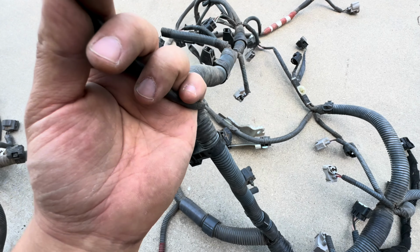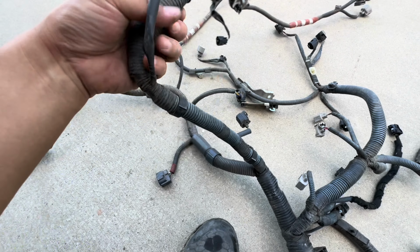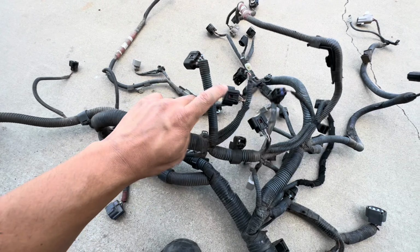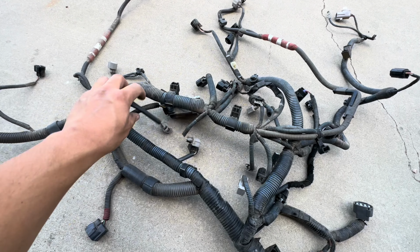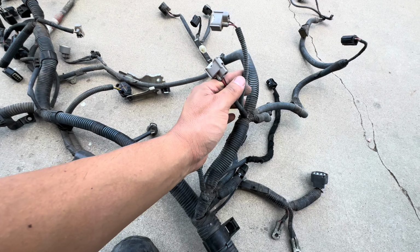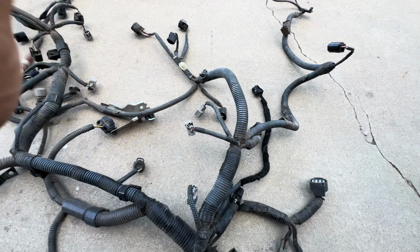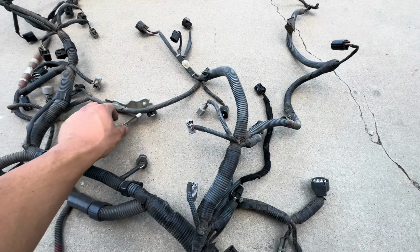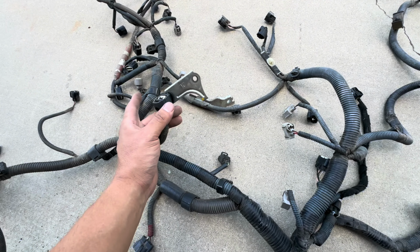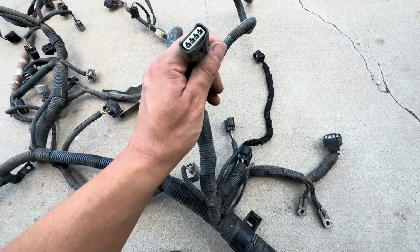And I'm thinking this might be the issue of my misfire, because this looks like, I think, injector plugs, but I'm not entirely sure. You can see these are the coil packs, and then I think these are the injectors. So injectors on each side, and I think that's the whole reason for my misfire, cylinder 6. And yeah, the mouse has destroyed this harness. I'm going to use the plugs though for the other harness, because like I said, that harness is kind of crushed up.